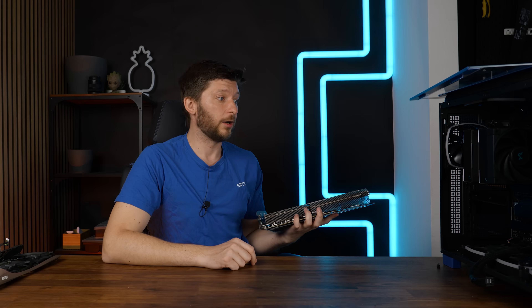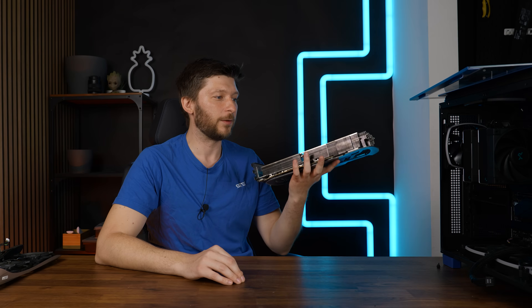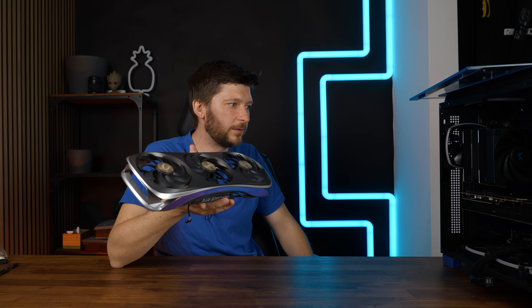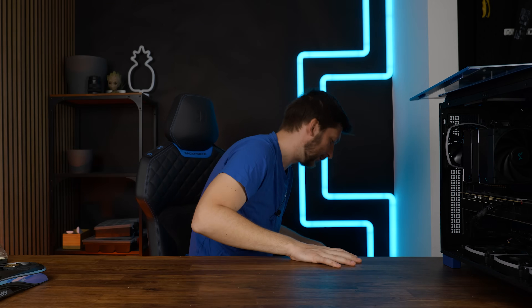I will now repeat the three tests. I can't force the fans anymore, but I can see how it performs out of the box with no fans, and then see if I can manipulate the bottom fans to keep the GPU at 50 degrees. If you're asking if the GPU has become a lot lighter, the answer is no — this plastic shroud weighs like nothing. It's a lot thinner now, really like a three-slot GPU. Also, the fan ramping on startup is gone. That's nice.